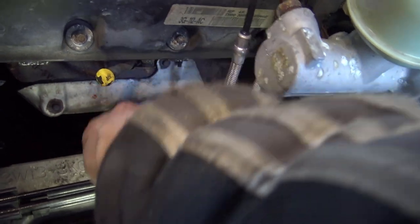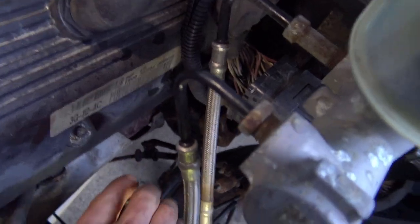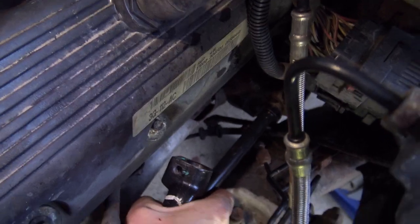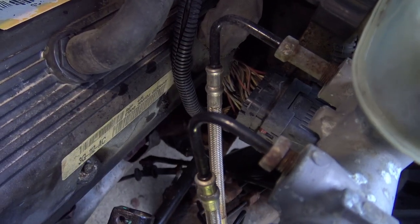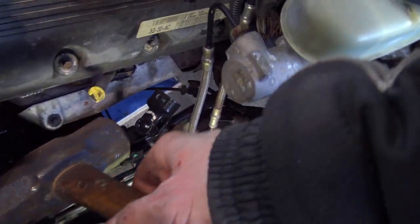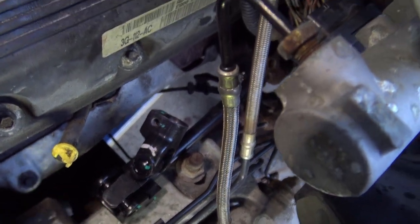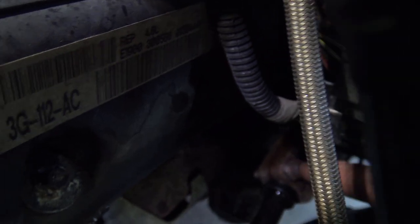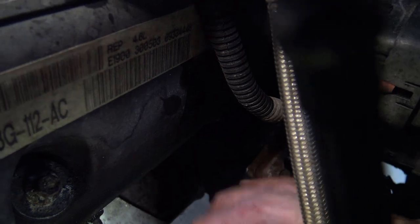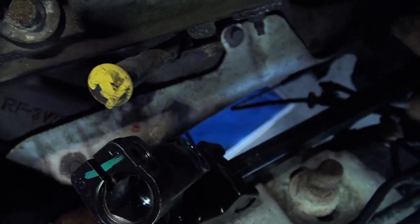I've cleaned the shaft. So I've cleaned the coupling for the upper shaft. And now I'm just trying to get it inserted. I'm gonna insert the top first and then the bottom. This one's kind of tight, so I'm using a little persuasion. Just lightly, it's going in. As you can see, I've got the 13 mil pinch bolt installed. It's not yet tightened. So the top part of the shaft is installed. Now I have to do the bottom part.